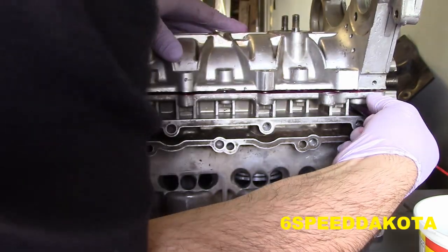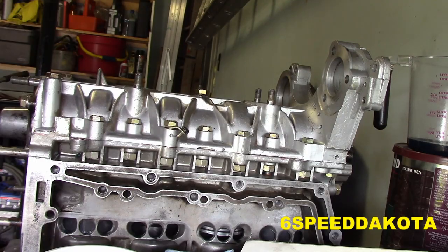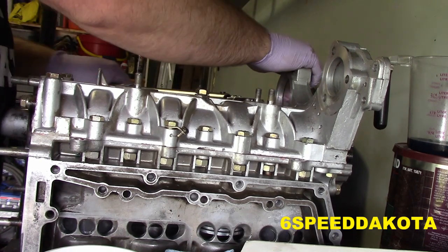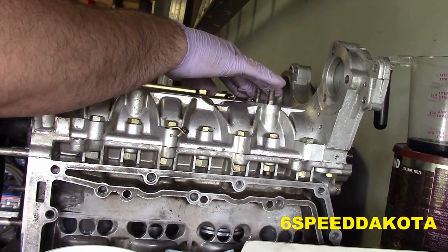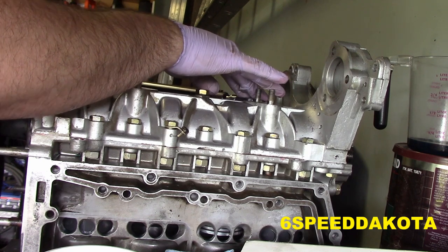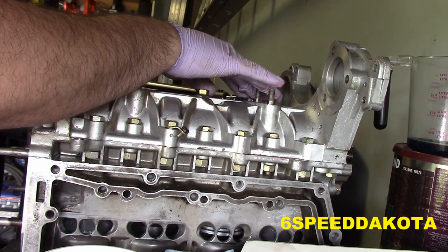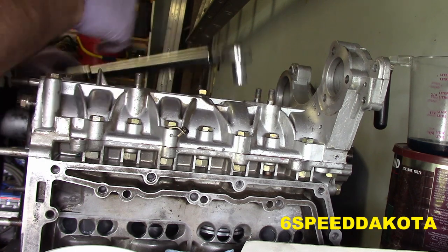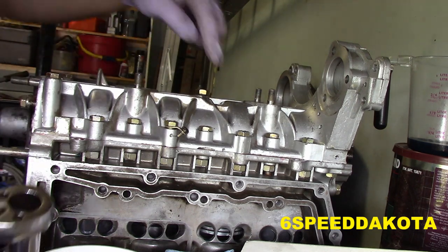Stay tight to the bottom bearing here. And this guy, there we go. Okay, so torque spec is 150 inch-pounds, which in foot-pounds is 12 and a half. So, starting right in the center here,